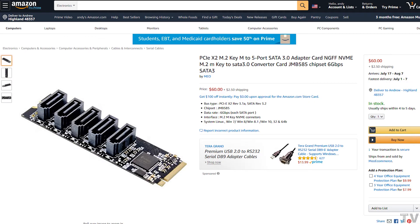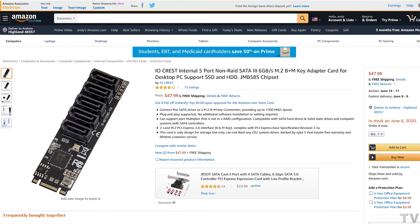Here's a device very similar to my Sedna M.2 to SATA port adapter, but it's a lot less money. This particular product is really super inexpensive compared to the one I bought, and it also uses two lanes of PCI Express 3.0. Some products may give the illusion that they're using four PCI Express lanes, but they might only use two lanes.